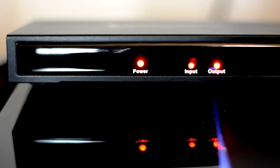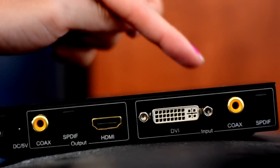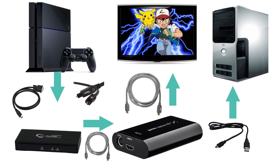The PS4 is going to be a little bit more tricky. You're going to have to add on a couple of extra components and cables to bypass HDCP. It's nothing too complicated though. My personal solution is I picked up the Monoprice DVI and SPDIF to HDMI converter. I got mine off Amazon and it'll run you between $45 to $50. It makes your live streaming look so much better than the on-console Twitch TV app, so if you're serious about live streaming I highly recommend it. You'll also need an HDMI to DVI cable as well as an optical cable — both plugged into the back of your PS4 going into the converter box. Then take an HDMI cable from the converter box out into the Elgato in. From there the setup is the same as the Xbox setup, so just refer back to that chart.